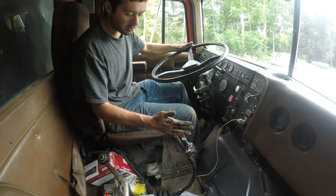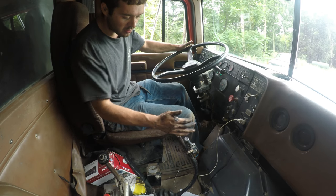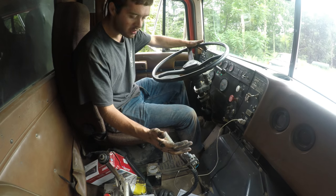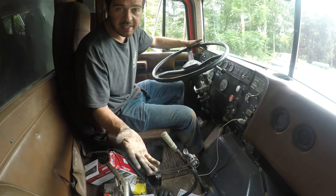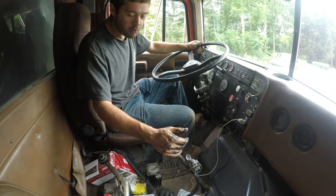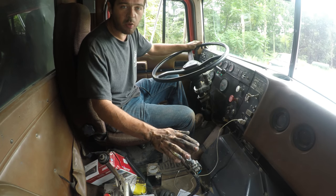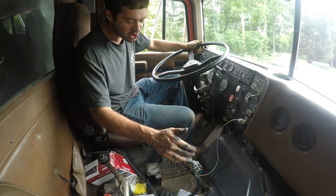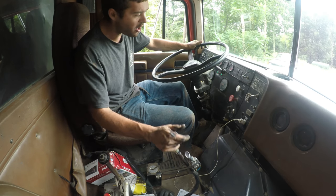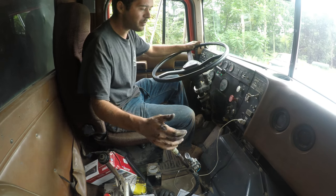Now watch, I'll do it grinding all the way. Brake. Goes right in. Halfway, grinding, all the way, goes right in. That seems like it's working fine. So I just have to remember not to step on the clutch all the way while the truck's moving. Now, it could be adjusted. The clutch pedal doesn't have as much throw. It's not going down as far, but it's still acceptable.